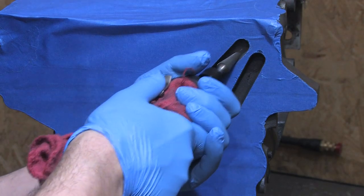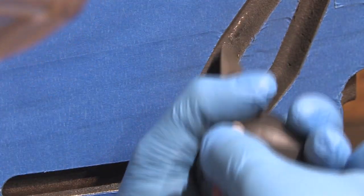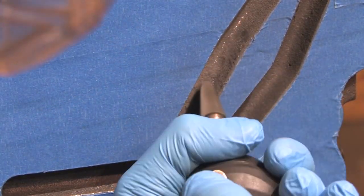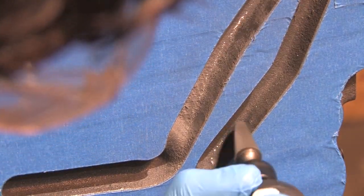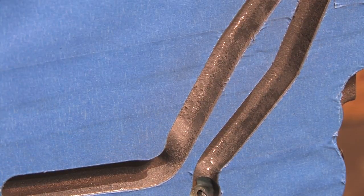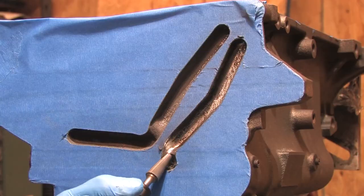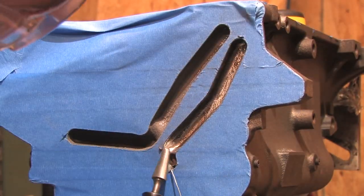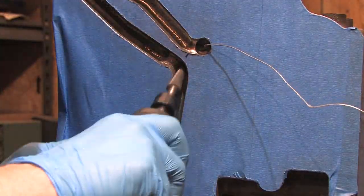Don't oil anything. Use a double cut carbide burr — mine's tapered with the round tip. Place the straight edge of the bit flat against the oil gallery and make a pass. The burr won't penetrate enough but to shade a tiny bit from the surface, but it cuts through the flash like a knife through warm cream cheese. If you press hard — just why would you do that? But when you do, it will cut the shape of the tool into the part. So to keep from creating distortion, be aware of your pressure and keep the tool moving. If you linger in one spot or zig zag, you're going to create troughs in the finish. Grind on the axis of flow. When you want to contour shapes into the parts, you just vary your angles and pressure, but still keep the tool moving.